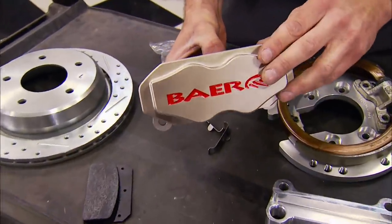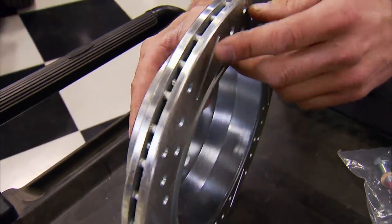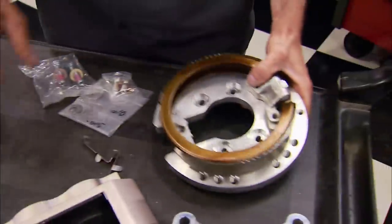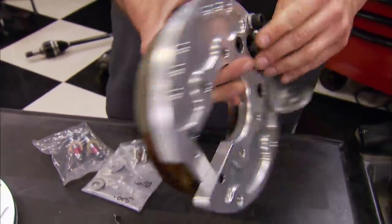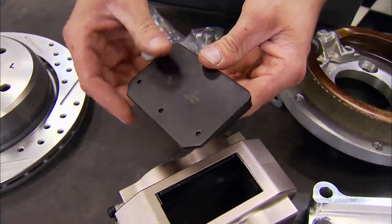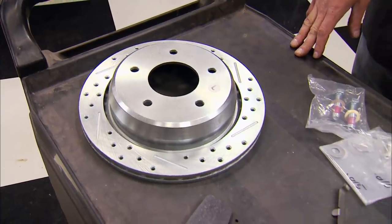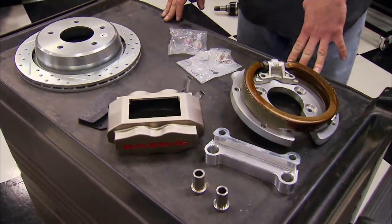Here's a way to get the benefits of larger rear brakes inside your small-diameter wheels. It's Baer's SS-4 system that uses a compact four-piston caliper, a 12-by-1-inch rotor that's cross-drilled, slotted, and vented, and a self-contained emergency brake built onto the backing plate. The two-piece billet caliper uses a brake pad shared with many aftermarket brake companies, so finding them is easy. The kit's designed to fit inside most 15-inch wheels. All components meet DOT specifications and are legal in all 50 states. Contact SummitRacing.com.